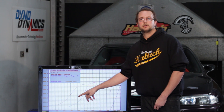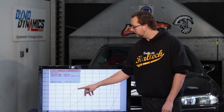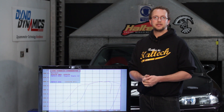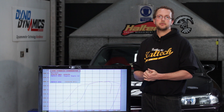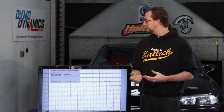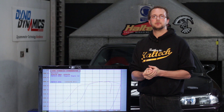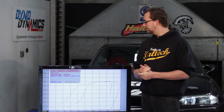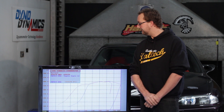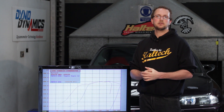To make these cars feel more powerful and make more power in these areas — around 150 kilowatts for the Supra or 350 kilowatts for the R35 — the difference is in the way that we do the boost control. Using a traditional bleed tap or straight off the wastegate, the turbocharger is going to come on and be a lot more lazy than it would be if we were using a closed loop boost control system, where the ECU would allow the turbo to spool up as fast as possible and make as much boost as low as possible, but still retain the same overall boost pressure. By doing this, we will pick up somewhere in the vicinity of 20 to 30% more power right down low — where we're making around 150 kilowatts, I'd expect somewhere around 170 to 180 kilowatts in the low down areas — resulting in a better car to drive.